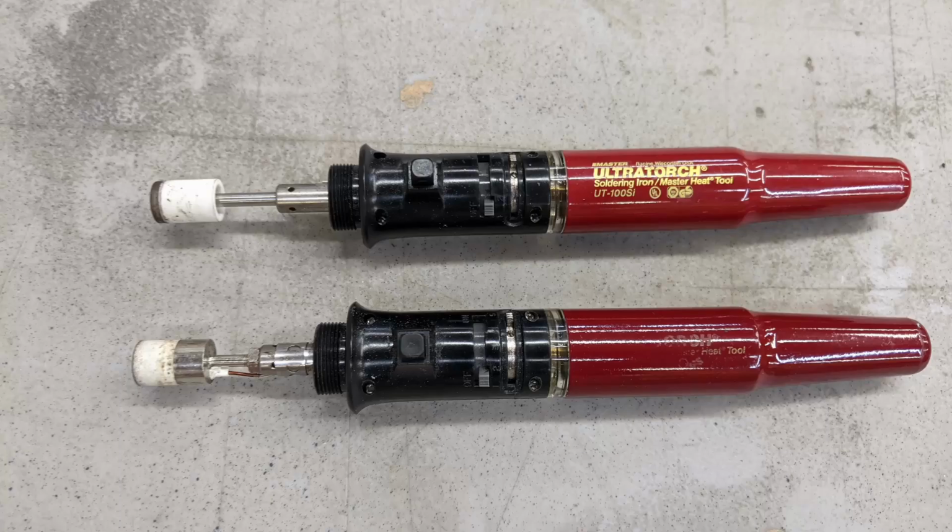Many technicians have been using the Ultratorch either as a miniature heat gun or for the ironing method. The older torch had some problems, and a lot of field technicians got disenchanted with it. Sometimes the self-igniter just wouldn't work. Of course, sometimes the catalytic converter part of it would go bad and you would need a new part. And then sometimes the gas that was being used, the butane, would plug up the filter. So these were all things that led to frustration out in the field. You can imagine getting started on a repair and being frustrated because your tool did not work.